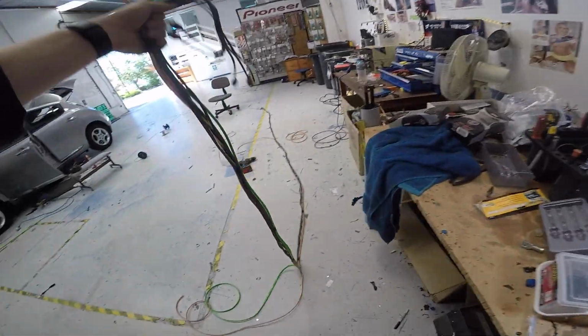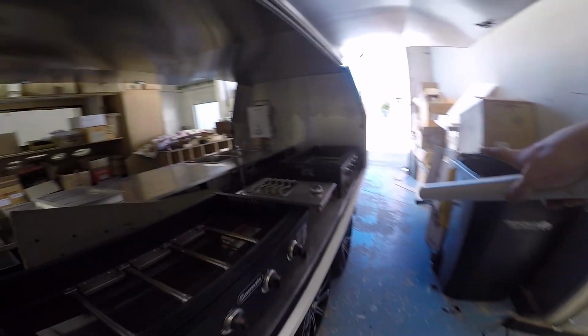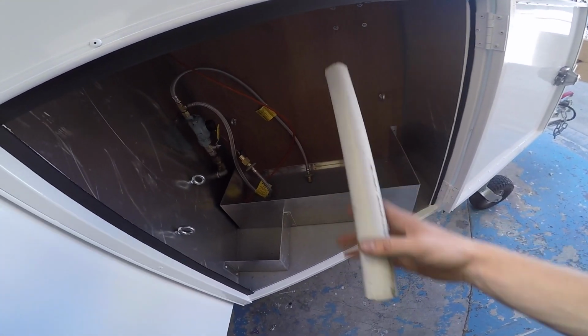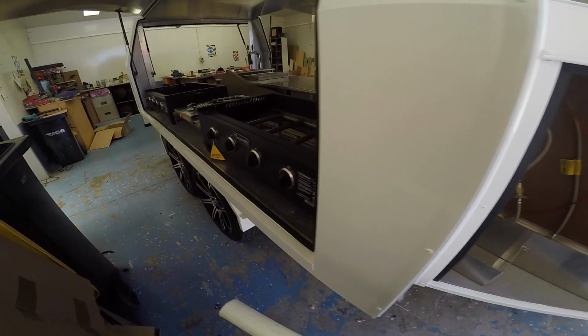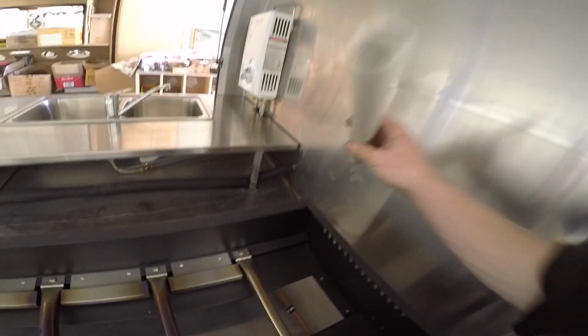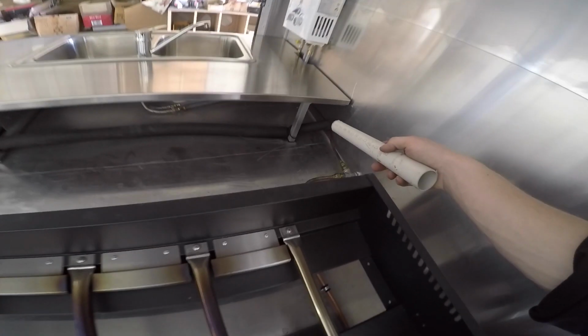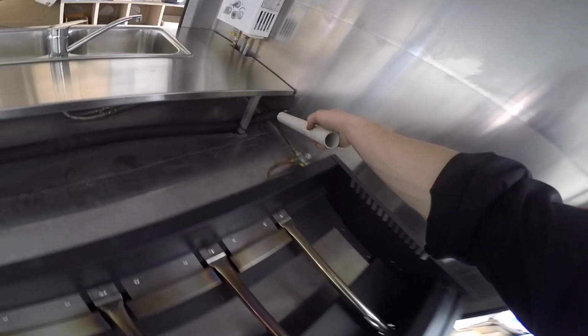It's pretty thick. The way I'm gonna get it through the wall, because this wall here isn't just one layer, it's two layers, this layer and this layer, I'm gonna have this piece of PVC tube going flush from this wall through into this wall about here-ish, I'm guessing. And then all the wires will come through there and it'll be siliconed into place. And then I'll probably conduit and cable tie it all the way along with this.